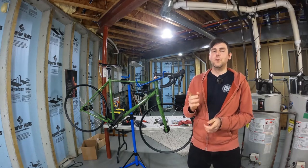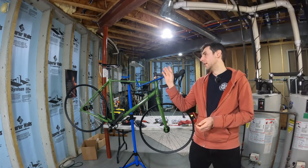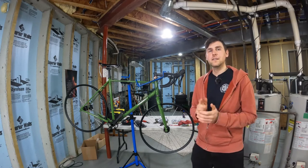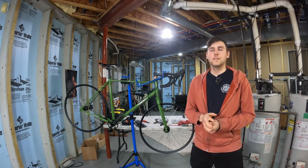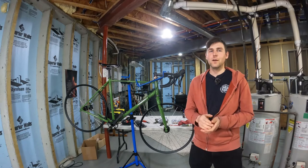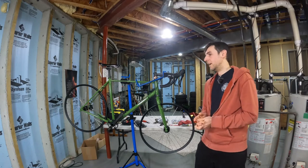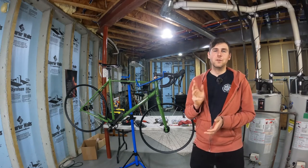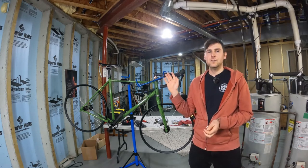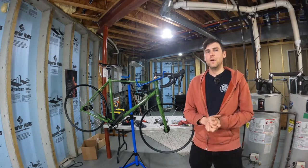Before I get started, one of you guys told me I should put some grease, carbon assembly compound, or anti-seize on the seat post — and I kind of stand corrected on this. I thought you shouldn't really do it. I've used grease before and it was a horrible mess. But if you have dissimilar metals you get galvanic reactions, and that can cause your seat post to seize in the frame. I've actually had a seized seat post before, so I really don't want that.